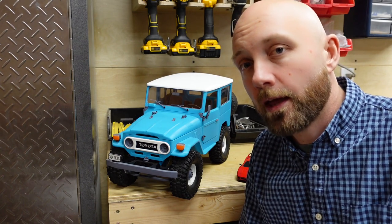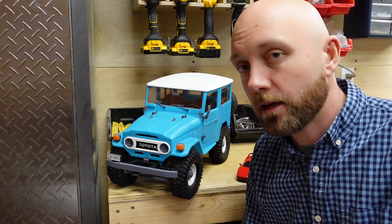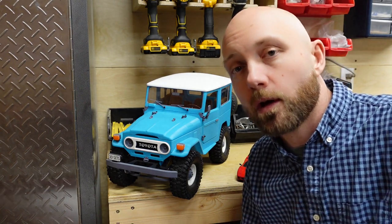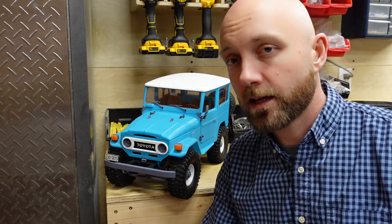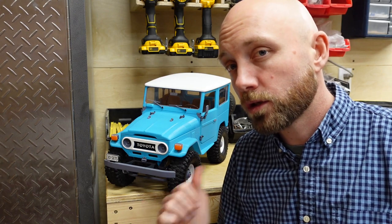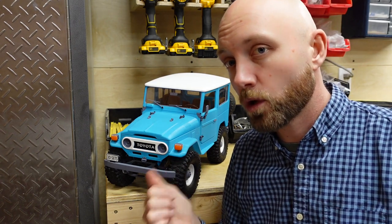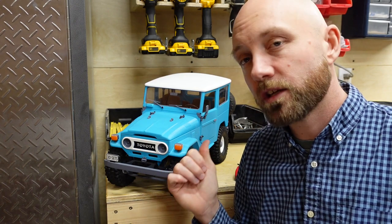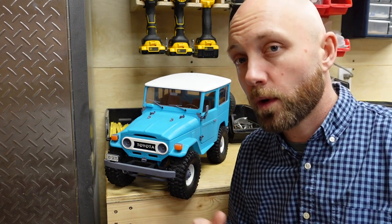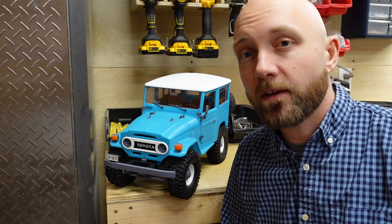You can build them using a standard 540 brush motor with a geared transmission, or upgrade to the brushless C3530 motor and a belt-driven drivetrain, which is something we highly recommend. Just like the real trucks, all these 3DSets ones have solid axle suspension rather than an independent one, which isn't ideal for on-road handling but gives you an advantage off-road when crawling over obstacles or on bumpy terrain. All versions come with build plates sized for a regular 220mm square print bed, but they also have plates available for smaller printers like the Prusa Mini. Building this Bamboo requires over 200 different 3D printed components, about 600 fasteners, and 40 bearings — so it's quite a project. If you're looking for a build kit, check out rcprinter.com.